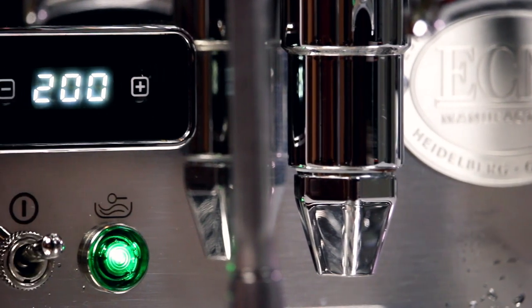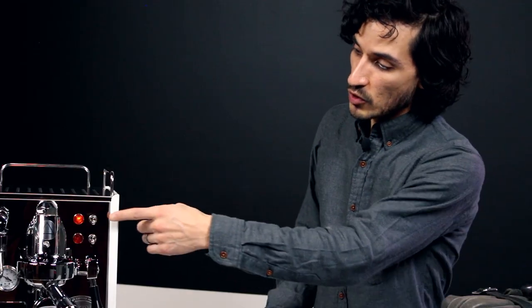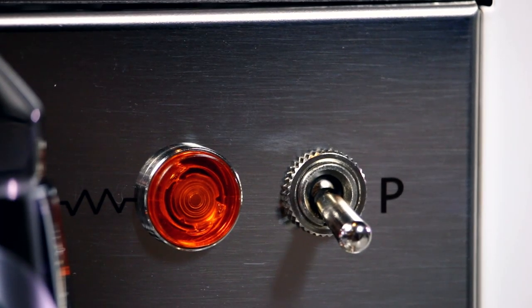As your boiler heats up, you're gonna see that feedback on the display. You're going to notice your orange lamp up on the top flashing as it heats that water up to your set point. There's a squiggly line next to that top lamp. That is your heating element indicator. You have a shot timer built into the PID display, which is useful for consistent recipes.